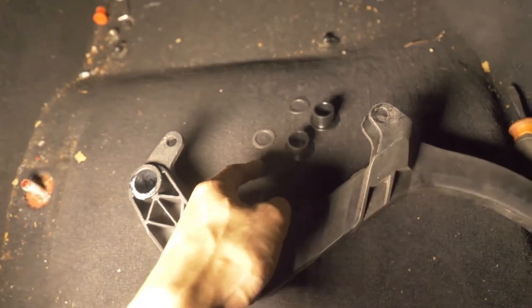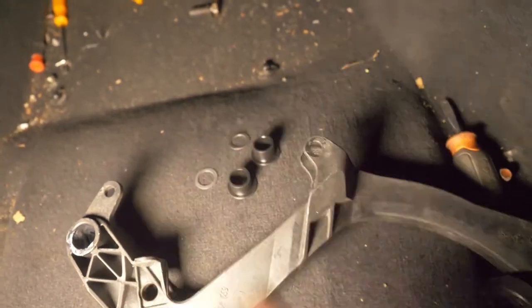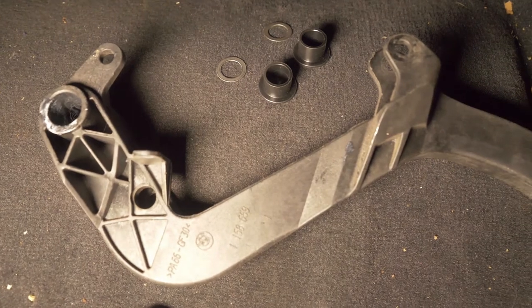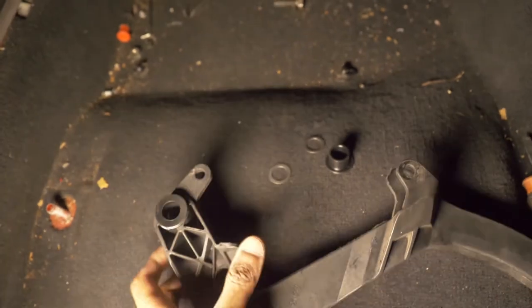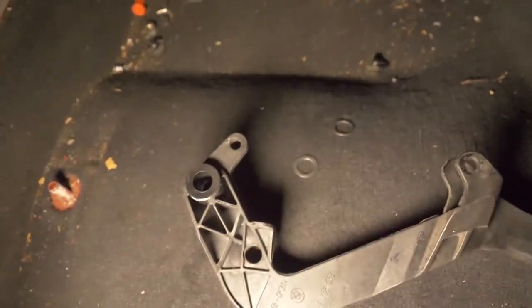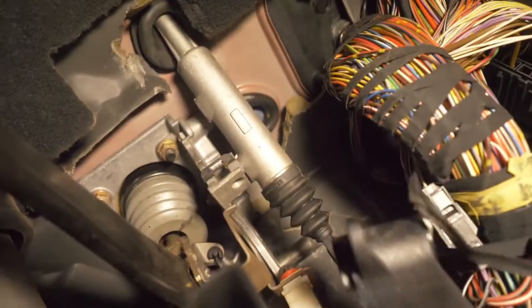The UUC comes with two bushings and two washers. One washer goes in the pin, then you put the bushing into the clutch pedal, and the other washer goes on the outside of the pin — the other side. Then you put the clip on. The washers are there to make sure it's extra tight and doesn't have any play. I've already lubricated them with lithium grease and they go on pretty easily. I'm also going to lubricate the inside and the pin itself.